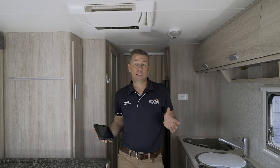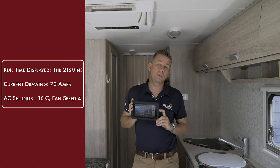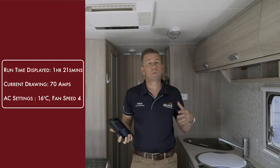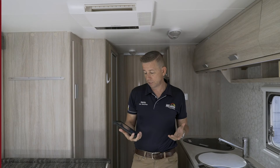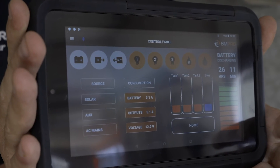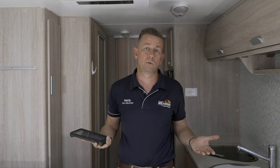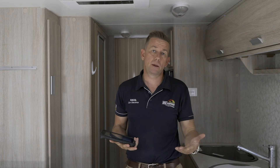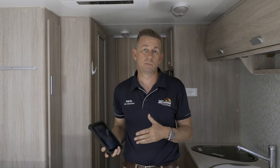It's been 10 minutes now. We've been letting this thing run flat out and it's nice and cool in the van - we've cooled the entire van down. We're still drawing 70 amps and it's showing that we've only got one hour 21 minutes to go. Remember we've got no solar running and a small bank of batteries, just so this will all happen quicker for a better demonstration. This is the J-Hub, which comes standard with a high-end Jayco - it's a nice gauge that shows run time in a simple way. I should also point out I've intentionally used AGM batteries so we can have a fluctuating voltage and monitor it as we go. With lithiums we'd have a consistent voltage and it would be harder to monitor this system.